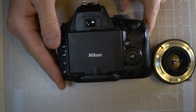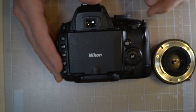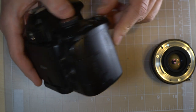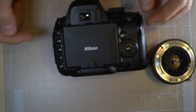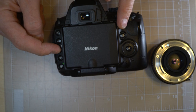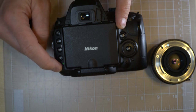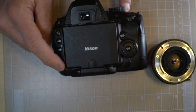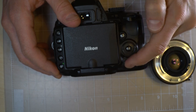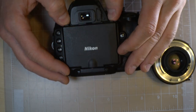On the camera's back, we have a bunch of different stuff. Up here we have the delete button, the viewfinder, and the viewfinder diopter adjuster. This is your auto-exposure lock and auto-focus lock button. This is your rear command dial — there's no front command dial on this model. Play button, menu button, thumbnail playback button, playback zoom button, information button with the green dot, live view button, OK button, cross pad, and speaker. This little light tells you that your SD card is being written to.